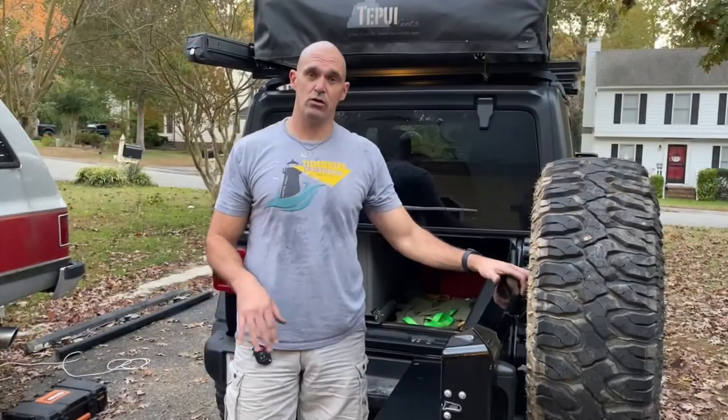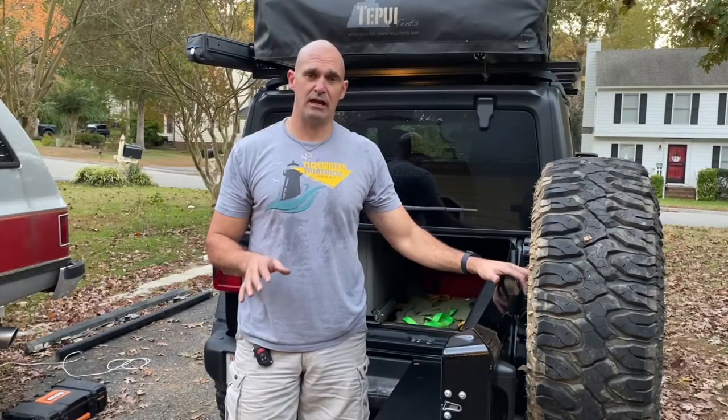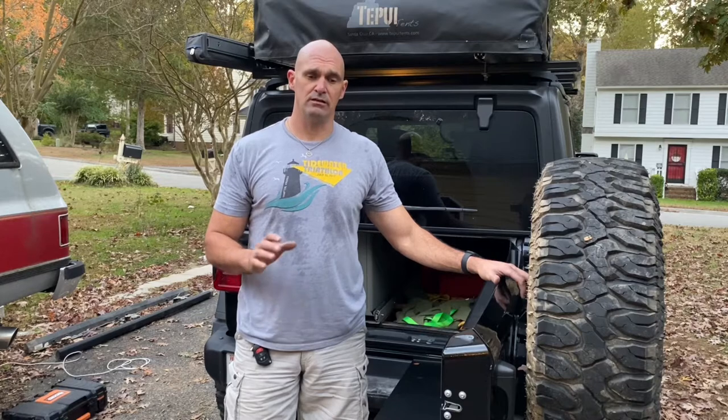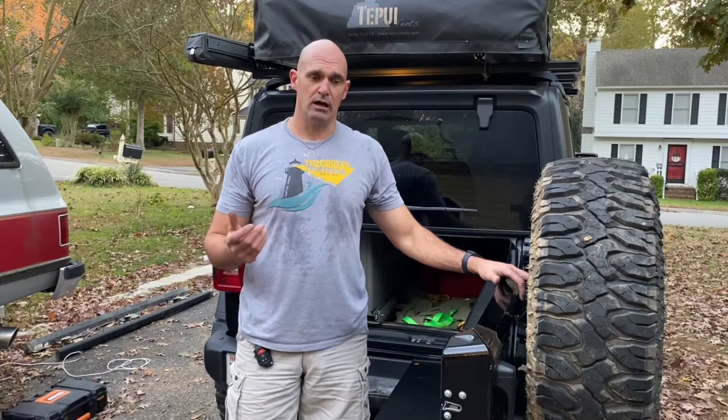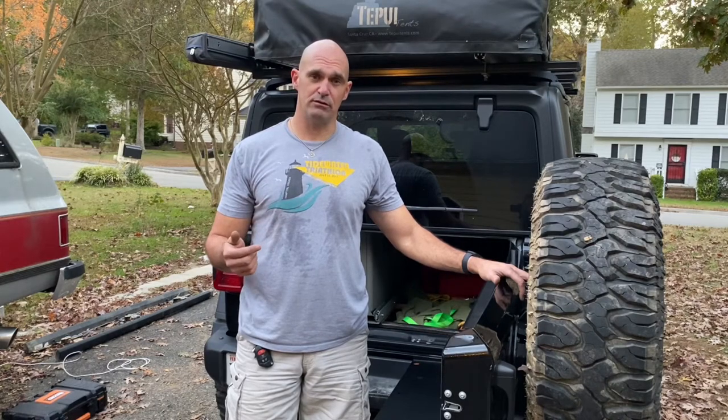Well, that didn't take very long. I'd say it took us about an hour and a half to get it all done. The only issue we had was with the three body to frame mounts. They were a little cumbersome to get off, just the way that it's set up. So with a little bit of time, a little bit of effort, you'll get those off.